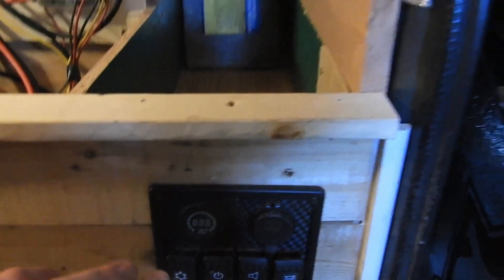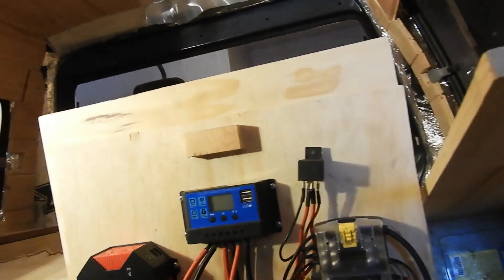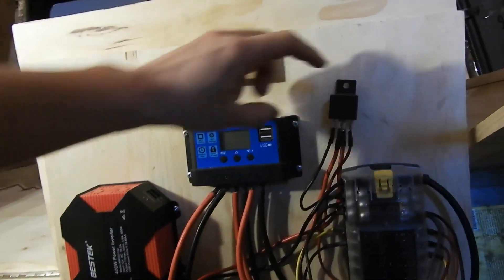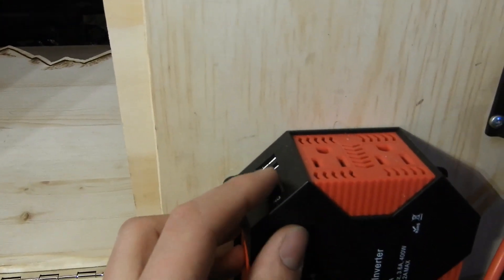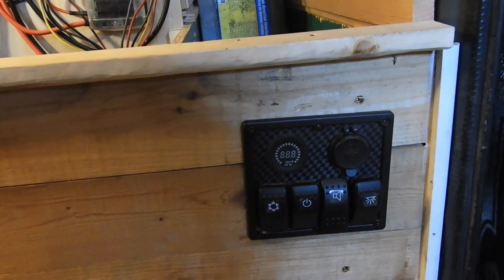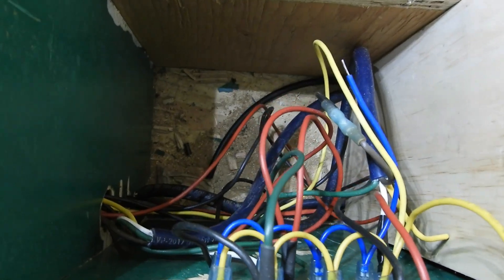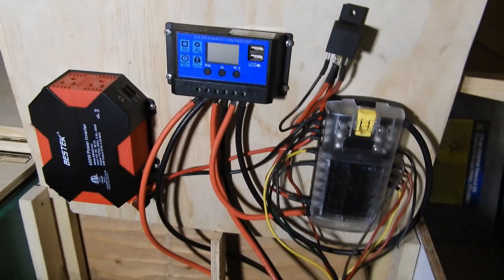Here's the quick and dirty on this. Starting from our switches: we've got our switch for our fridge circuit, and that's actually going to activate a 12 volt relay because there's going to be a constant circuit - it'll be better not to have that going through the switch constantly. This one is for our inverter, which activates a relay and sends current to the inverter. This switch is for our 12 volt audio amplifier. This switch is for our overhead lights. Wires come in through here, out through our bulkhead, and into our wire tidy area, and this is where our battery is going to live.